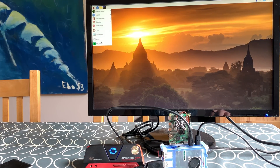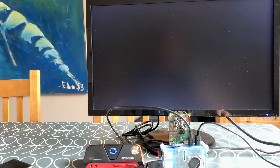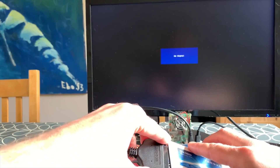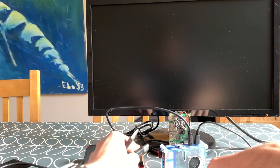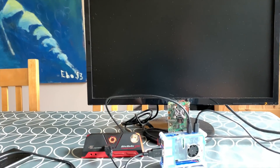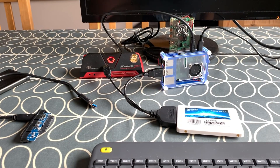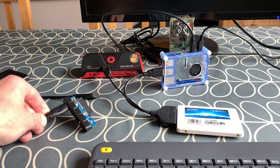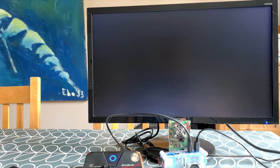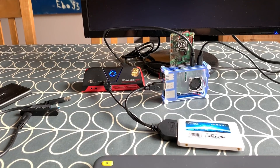I'm going to shut that down and do exactly the same, but swap the cable over. So that's off. Let's unplug that and use this SATA cable — it's more solid to plug in and out, so if I'm hot swapping it's a nicer one to use. So now we're not using the Dynamo adapter, which is what I use for most of my videos — we're using this Amazon one. It just flashed up a screen but then just kind of does this: it just sits and waits. It sometimes reboots, but it never really gets anywhere with this adapter, so it obviously doesn't like it with this particular OS.